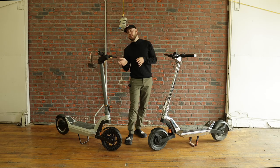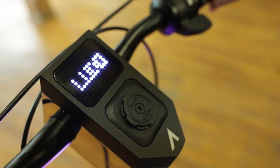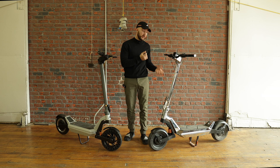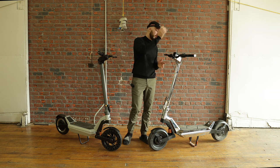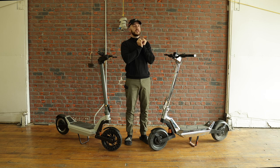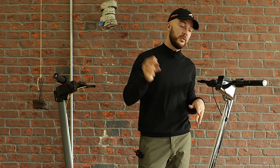Now you can clip your phone on. The other complaint was the lack of a display — people said at this price it should be included, and some don't want to ride with their phone on the scooter. So we decided to add a display, which was very hard since we designed the scooter without one from the start — requiring a re-designed controller and PCB. But we were able to fit a display, and it's by far my favorite ever seen on a scooter. It uses dots so you can see it from every angle without any reflection, showing speed, gear, turning signal, and error codes, with all other settings accessible via the app.